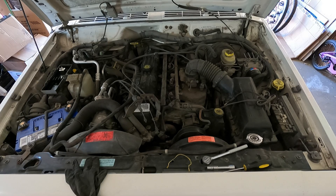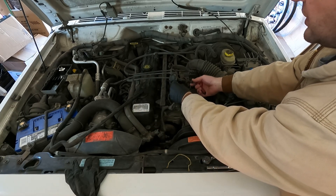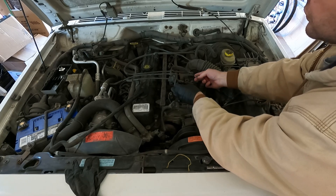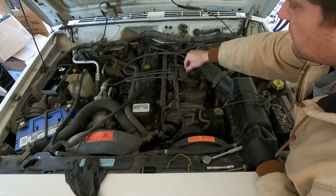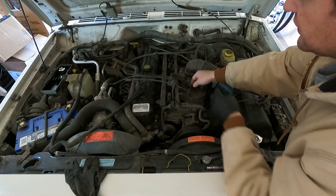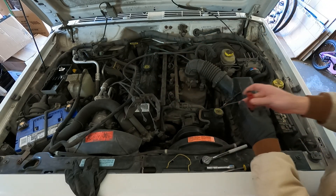The reason I wanted to start with this upgrade was because it can increase power and fuel efficiency. So if I'm saving fuel, the sooner I get these in, the more money they will make me over time. Let's see how they actually turn out. All I've done so far is disconnect these throttle cables — they just pop off, the two closer to the front slide, and then that one you push back towards the firewall. And then there are two 10-millimeter bolts there. You just pop those two 10-millimeters out, and that's basically where I am now.